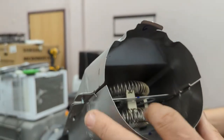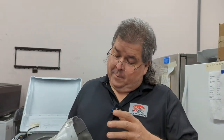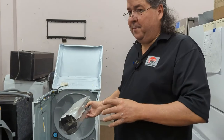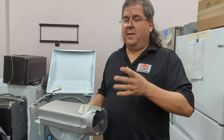Those coils have not been seasoned yet. What I mean by seasoned is they have not been ran through a heat cycle. What's going to happen is from the time it's made, till the time it's put in here, till the time it's put in your dryer, stuff and things can and will gather on it. So when you start to dry for the first time and you hit it, you get that smell and that smoke.